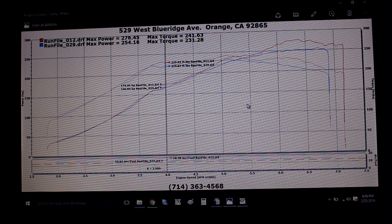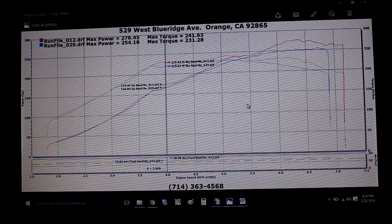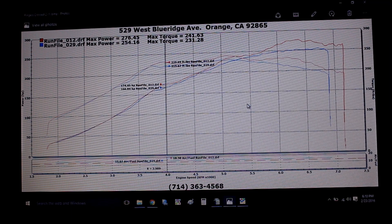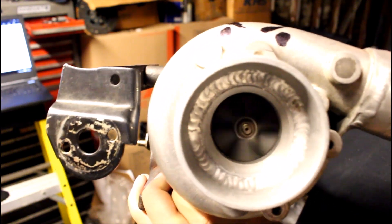Let's talk about the final numbers. I'm not saying you're going to slap this compressor wheel on your car and instantly gain 22 wheel horsepower, because there was some extra tuning involved. But what I did notice up top is I was able to get the wheel to easily produce about 2 PSI more boost, which really ramped up the top end torque and gave me that power. The wheel made it easier to do that because when I tried with the stock wheel, it just didn't want to flow enough. So pretty much what you're going to gain is a cooler sound, a little extra response, about 7% faster spool up depending on your setup, and a little extra horsepower that you can tune for. For the price they sell the wheels for, it's a pretty good deal. I'll include a link in the description - it's a sick product. And don't forget to subscribe for more Miata Turbo Madness.